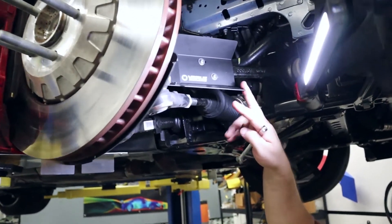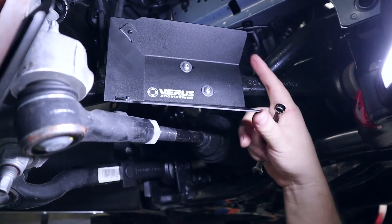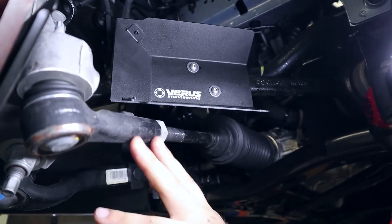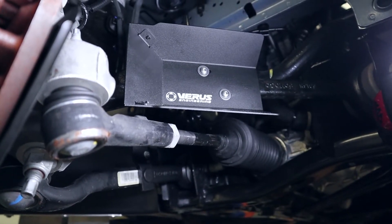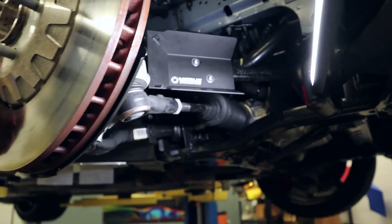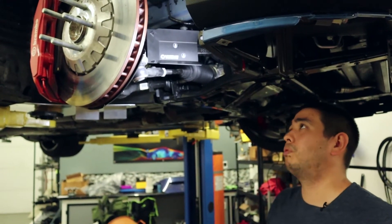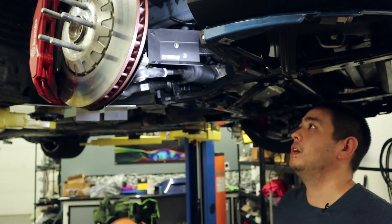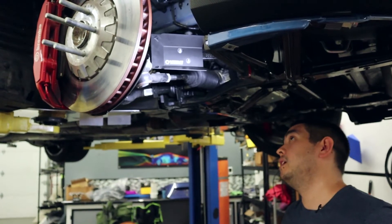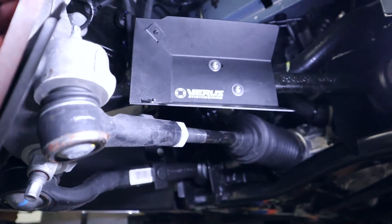As you can see, we have this installed now. The holes are slotted so you do have some room to move around. As you tighten this up and get it into place, you don't want it touching any other components like the tie rod end. These are M5 bolts, so you don't want to overtighten them — bottom the nylocks out and give them just a little extra, probably around five to seven foot-pounds. The nylock nuts on the back are going to keep these from backing out under vibration. A very easy install — two bolts, get it lined up, tighten them up, and put the car back down.